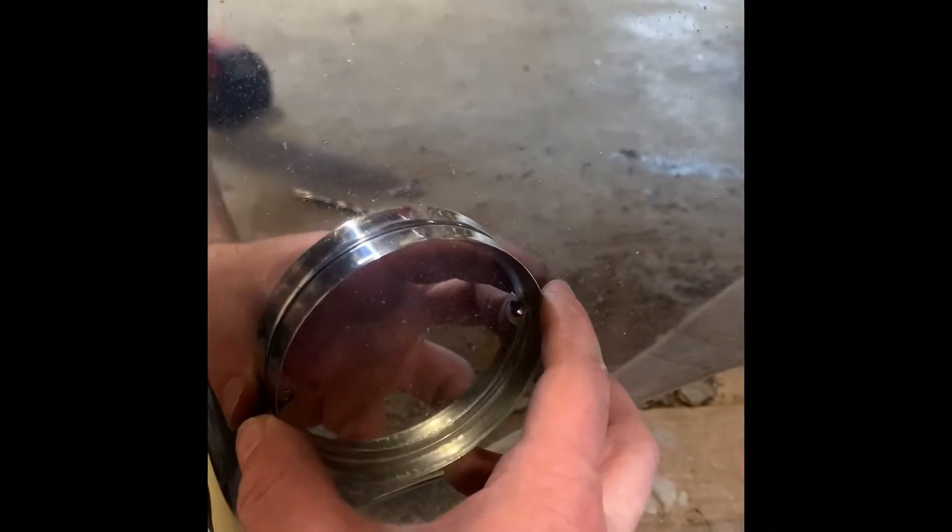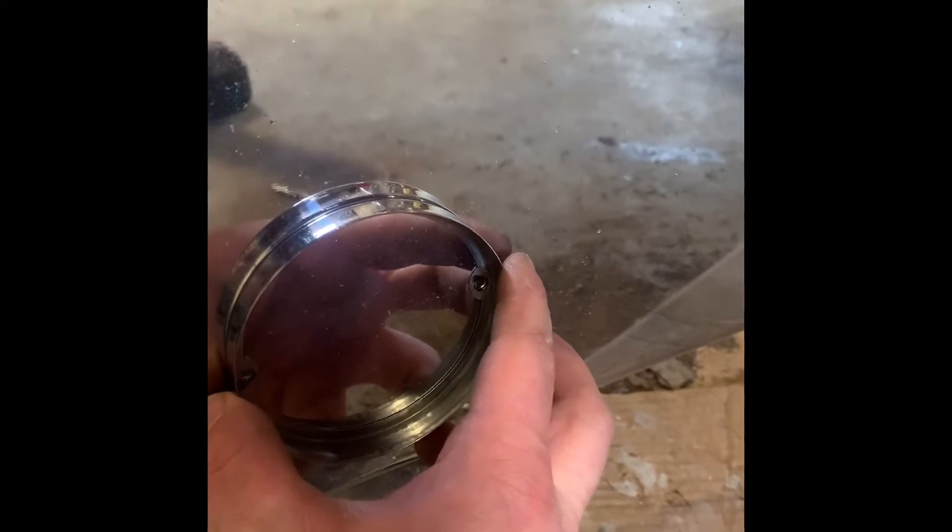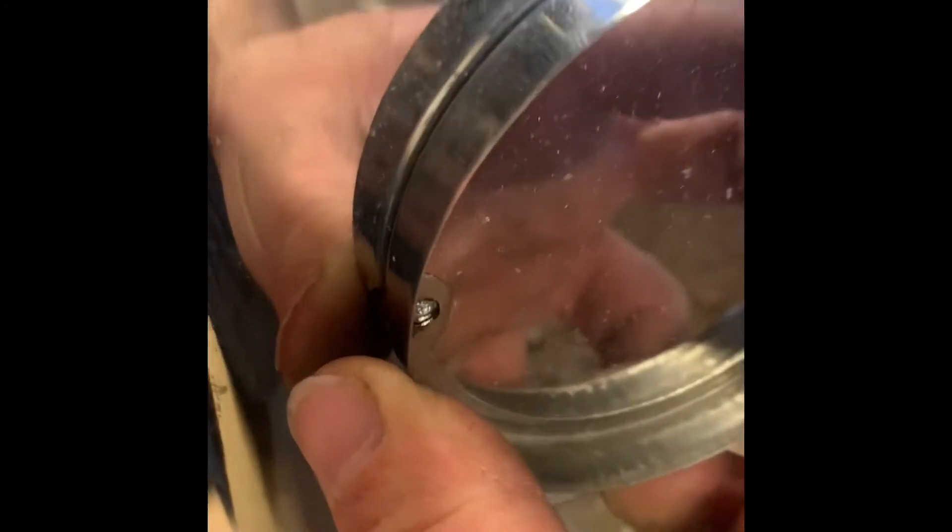You want to go an inch from the side and an inch from the bottom. Mark an inch here and an inch here. Then take your chrome ring and put it right there where the dots are, at the edge of the ring and on the bottom side. Then you get a perfect spacing from the edge and the bottom of the bumper.